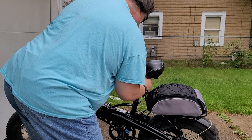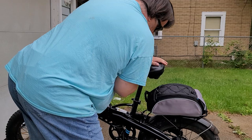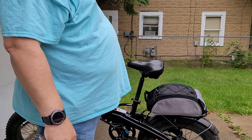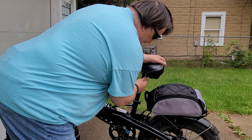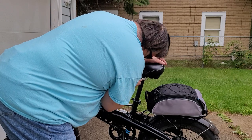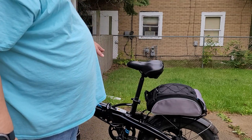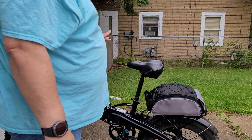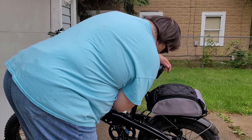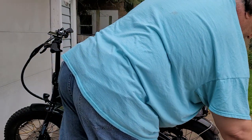Make sure the nose of your seat is in the right position. If you're having problems, you can adjust the seat backwards and forward on the rails to get a better seating position — there's no magic formula but try it and see. You want the seat pretty much flat when you look at the bicycle. You can go nose up a little bit, but you don't want it nose down — you'll be putting more pressure on your hands.